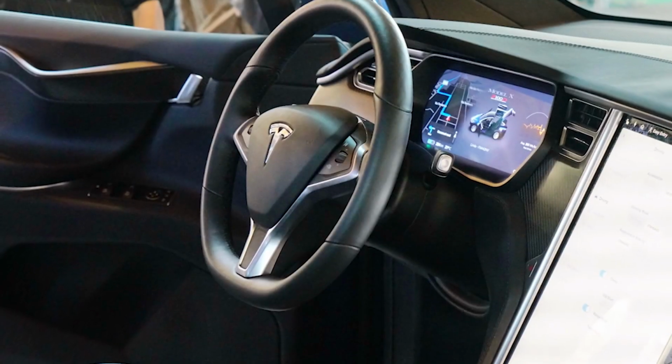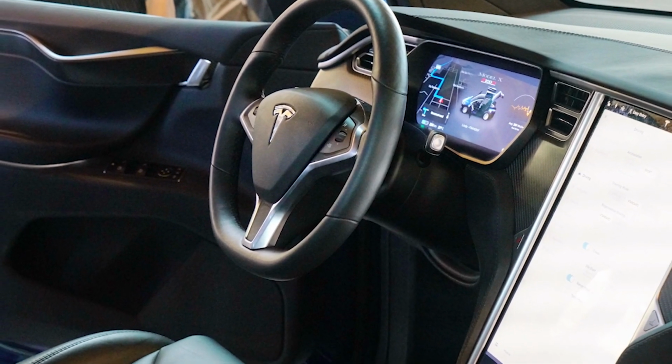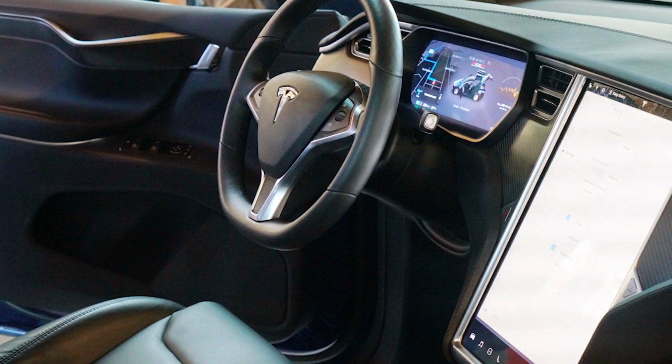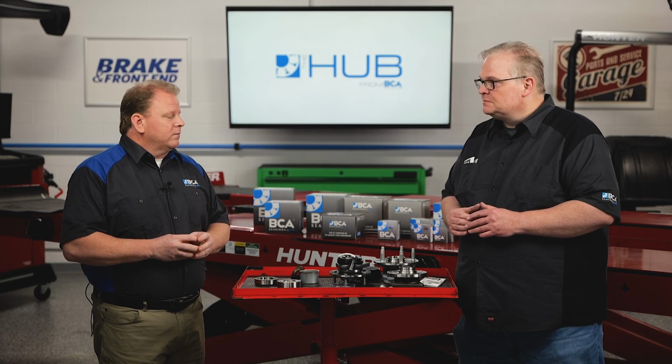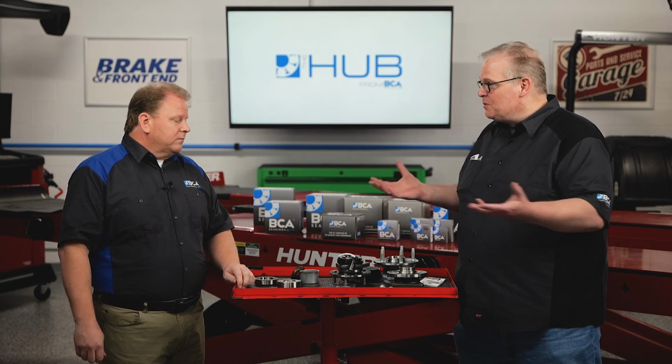I think the other thing a lot of technicians forget is to put this thing in a tow or service mode. First of all, after you get it positioned in the bay, and even before you get the lift arranged, this will help you to maneuver the Tesla in the bay itself to get the aiming of the lift arms correct. On Teslas with the electric motors, you're going to have drag, if you will. Hitting the switch is going to disable that, make it easier to move. Plus with the air suspension, you're not going to do any damage when you lower the suspension. Air suspension has been around with disable switches for a while, so they should be somewhat familiar with that. But accessing that is through the screen in the menu board. Beyond that, it's pretty much a conventional wheel bearing on these vehicles.